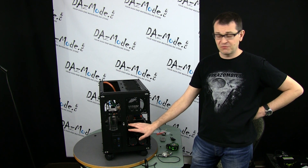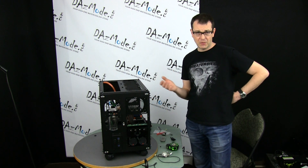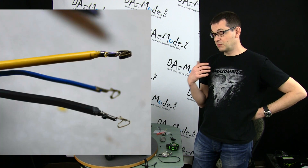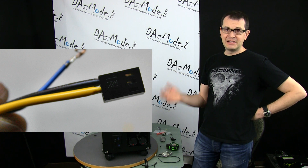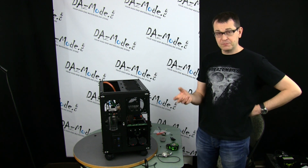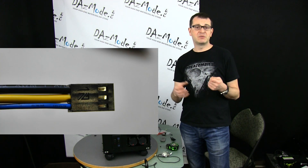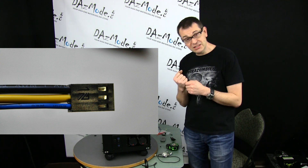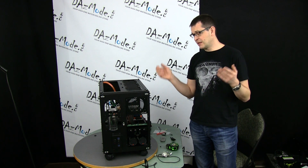I also put a 3-pin connector on the D5 pump cable so I can power it from the fan controller. I have a 30-watt fan controller, and from the pump spec the maximum draw is 17 watts, so we have quite enough headroom. The only challenge is that the D5 cable gauge is outrageously large — you simply can't crimp a fan pin as-is. You have to shave a little insulation to make it smaller for crimping, and the cable is also too thick to fit the connector itself, so you need to shave more to narrow it down. When it's done it works out well though.